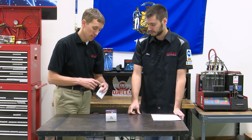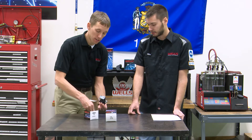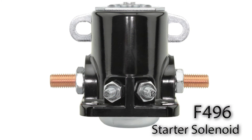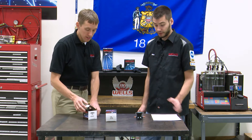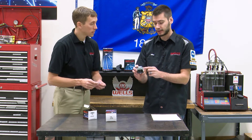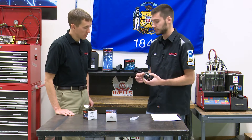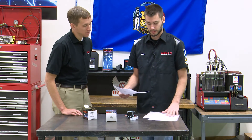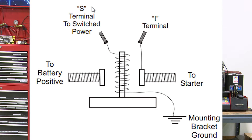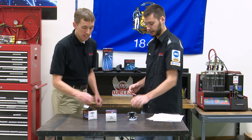Let's look at what's in the box. The F496 is a pretty common-looking solenoid — many of us have replaced this on Ford vehicles, sometimes mounted to the firewall or the fender. One important thing to note: the F496 has a metal bracket that needs to be bolted down to something clean and metal in order for the solenoid to function. Our wiring diagram on the website shows the ground comes through the mounting bracket, so it must be bolted to a clean metal path to ground.